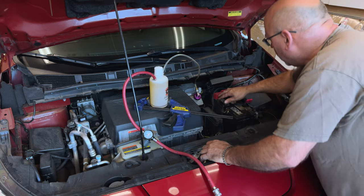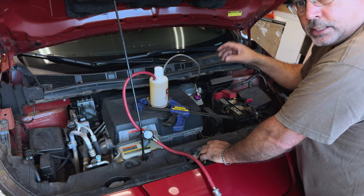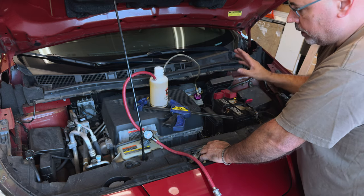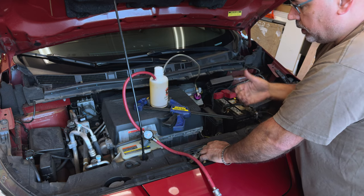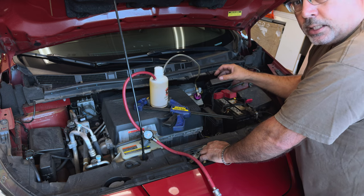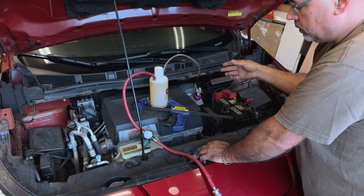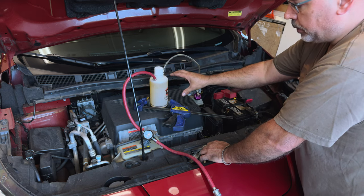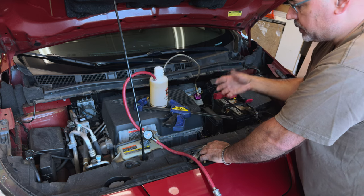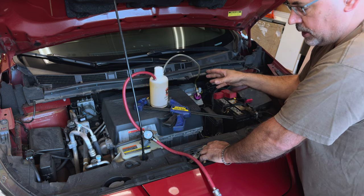This particular one has two lines coming out to the front, and we have an ABS pump over here with four lines out to each wheel, so we can individually brake the wheels depending on what the ABS wheel sensor is telling it. There's a lot going on here — it's a lot of money. So why not flush it every two or three years for 10 bucks worth of fluid? I find that about three years is where I get to with this DOT 5.1 — just getting to the 2% moisture level.